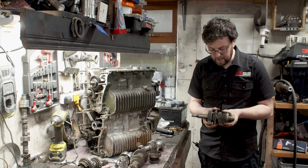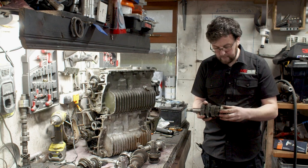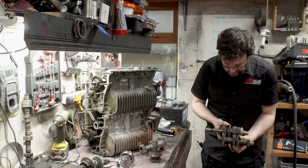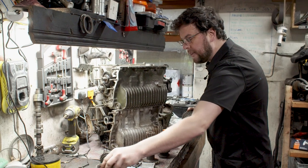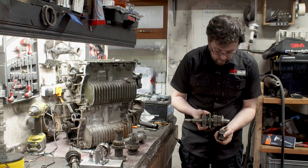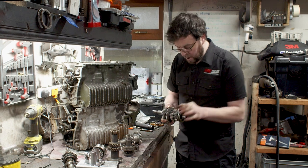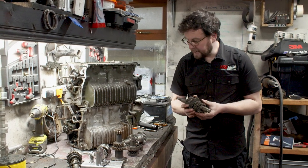The second reason dog engagement is preferred in racing is that the clunky gear change is an acceptable trade-off for fitting much bigger gears. These gears are nearly double the width of synchro gears. We get that space back by removing the synchro hub. Looking at the size difference — the selector hub for a balk ring setup versus the selector ring hub for a dog engagement kit — it's almost double the width. By removing that space from the gear cluster, we can make all the gears wider, and wider gears are stronger.